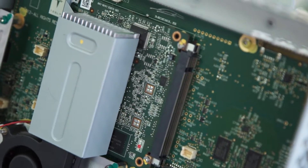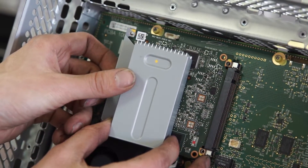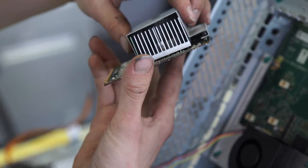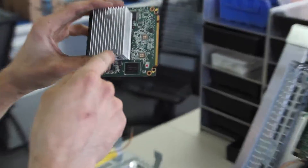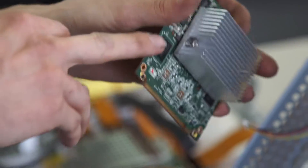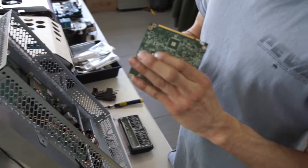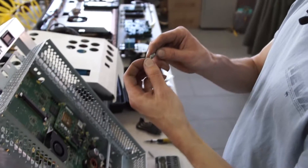Next are our T6 screws. Now that we've got our screws out, the card goes up at an angle and then out of the slot — just pull it out as one unit. This heat shield right here kind of slides off this way. Then we've got some hex keys inside — we use a two millimeter hex key to remove the heat sink, which is held by two screws, some springs, and nuts on the back. Just hold the nut in place so that it threads out the hole, then put the nut back on.